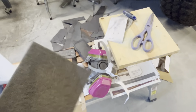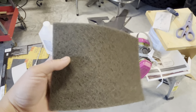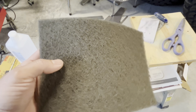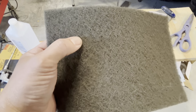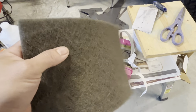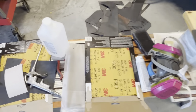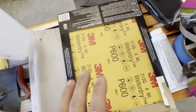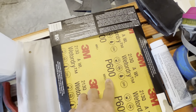First thing first, I'm gonna scuff the whole car down with this scuffing pad. It's really a good idea to just run through the entire surface with this — it's gonna remove anything like a little piece of dust that lands on top of your surface. You scuff this down and all of that is gone. But for the bigger stuff that really needs to be removed, I have different grades of sandpaper. This is 600 grit right here.